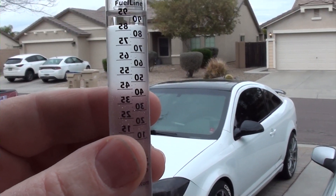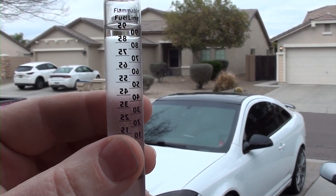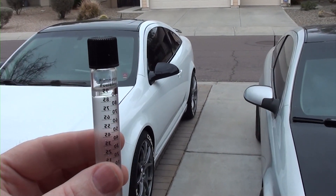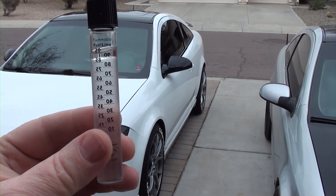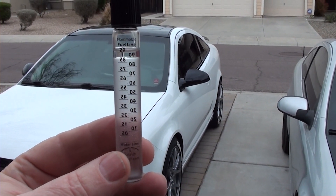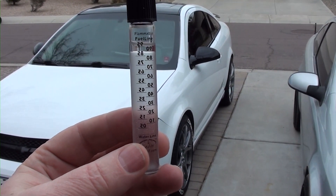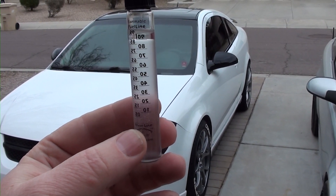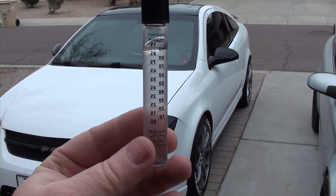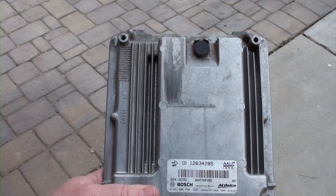You can see it's a little hazy at the bottom, but the E85 I'm running is close to 90%, which is awesome. If you get a good gas station, it can be hard to find good E85 in Arizona. I found this place on Val Vista and Broadway that has great fuel. That's how you test it — just a little water and the E85, shake it up, let it settle, and it tells you exactly what your ethanol percentage is.